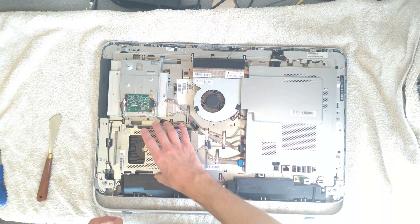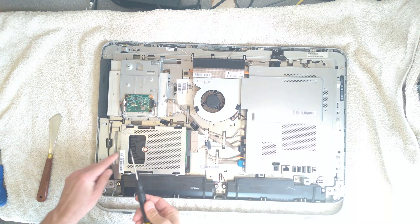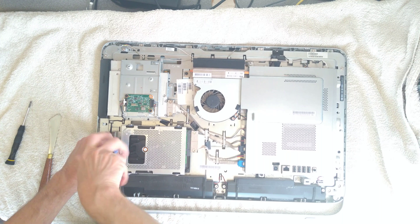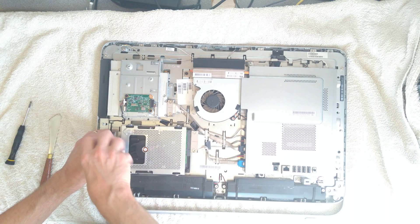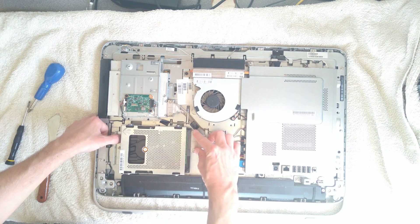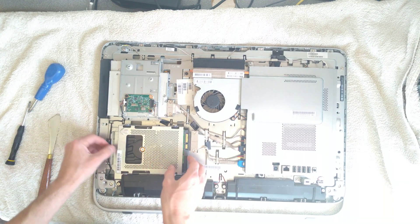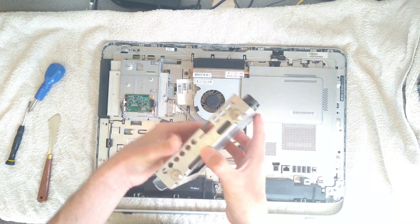So now we're into the machine, I want to remove the hard disk, which is also an unusual size. You can't use a small screwdriver — you need to use a fairly big tipped screwdriver. That one's a retained screw, so it doesn't fully come out — it'll just unscrew and then become springy. These two remain screwed in because the whole thing's on a bracket. And gently pull. If you didn't do it gently you'd end up slamming the drive over into this end stop here, potentially causing damage if you did it a bit too forcefully.